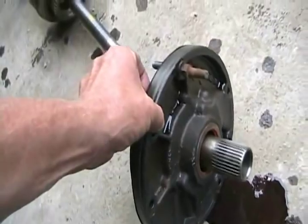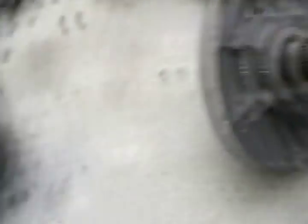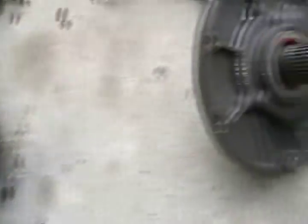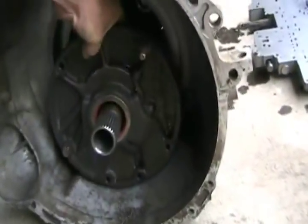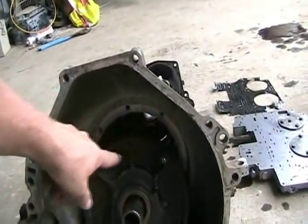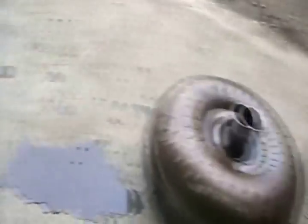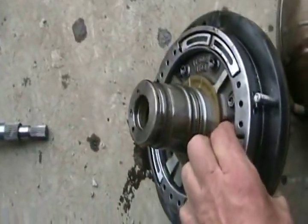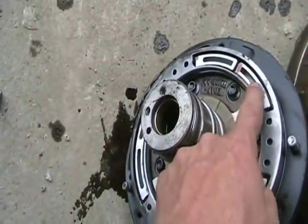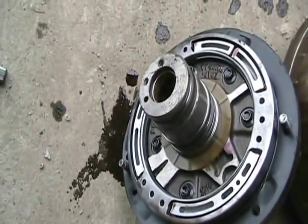This is the front input side of your transmission. This is called your front torque converter seal, which seals around there. If your transmission leaks oil and the oil is coming out of the bellhousing dripping underneath, that's likely the seal that needs to be changed. Unfortunately, you have to take your whole transmission off the car to do that. This is the first part you see inside the bellhousing of the transmission, all bolted into that hole. This shaft is actually a stationary shaft, and it holds one of the sets of spinning cups stationary. These little pads are part of a piston system — they move out by oil pressure behind them to actuate a clutch.